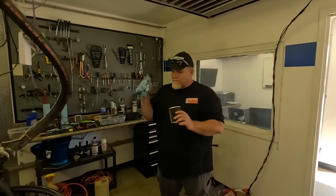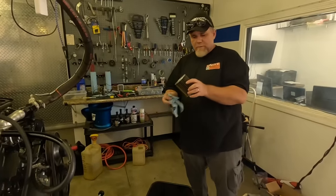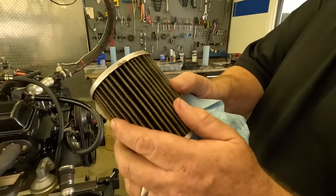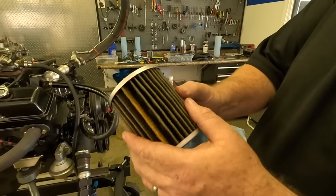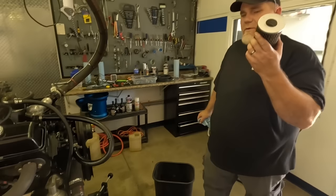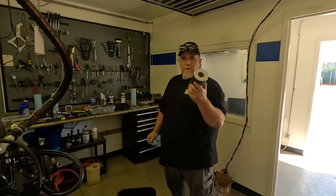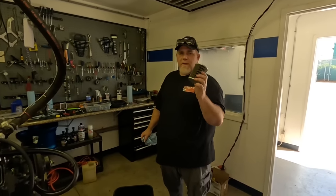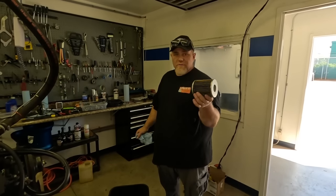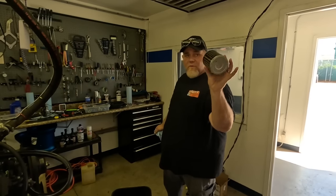All right, so Joe just drained the oil out of the engine. I just cut the oil filter open, and it looks like we got a good clean bill of health here. There's nothing in the pleats. I took it out in the sunlight. I would rather be safe than sorry any day of the week, because once you start hammering on it, things can go bad really quick, ain't that right, Joe? Absolutely. So if you wait until you hear a noise, you've actually waited too long. This here tells you if you got a problem before you can hear it.